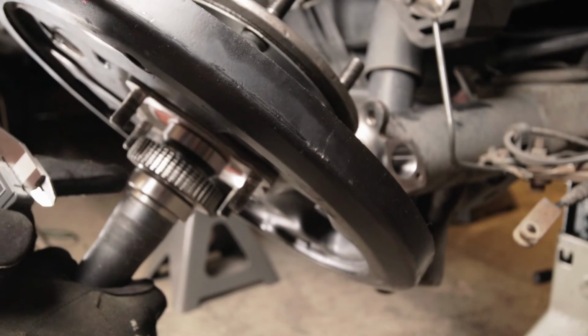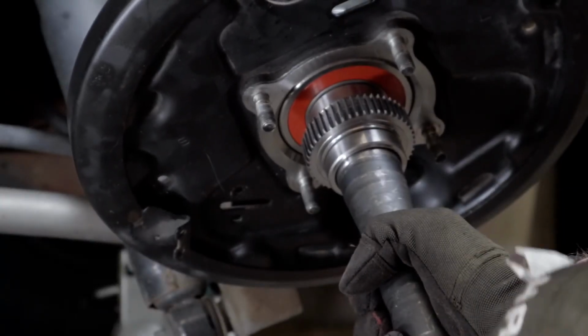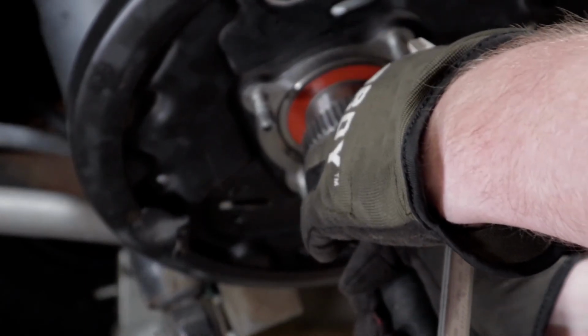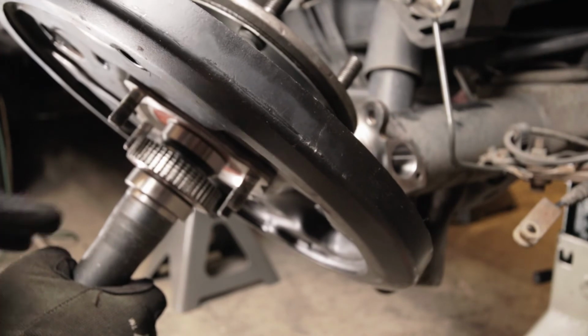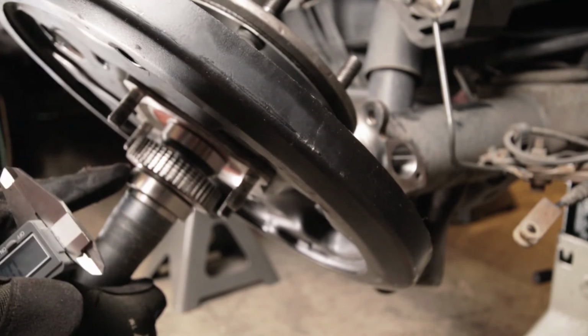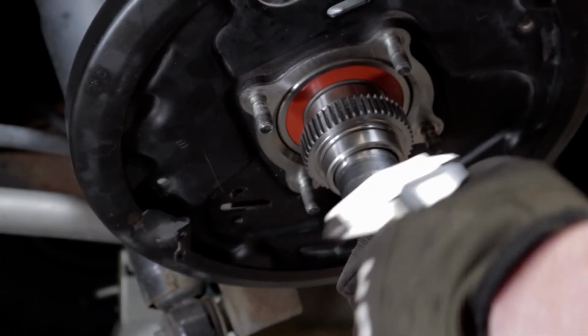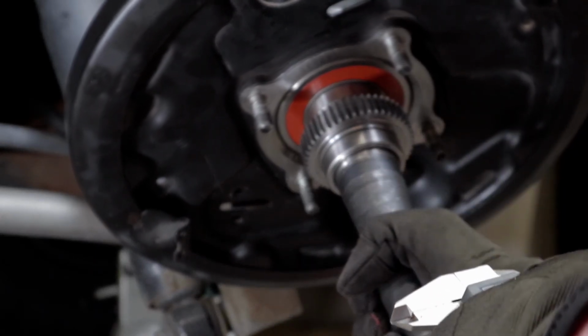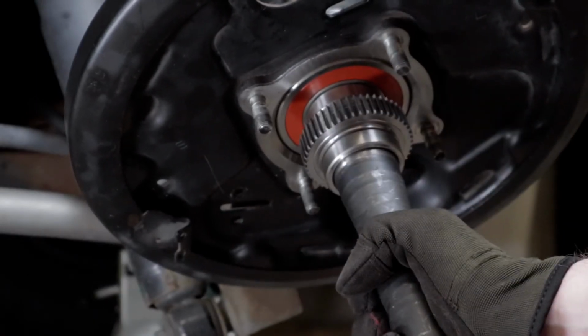And so that gives you more room, because the way these seals are, they redesigned them and it moved the surface of the seal, or the edge of the seal, outboard a little bit to where it ended up closer to this bevel. And so what you can do to prevent that is flip the bevel, then it ends up being more polished surface area of the retainer, that then allows for a little bit of travel, and that seal will seal a little better.